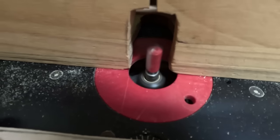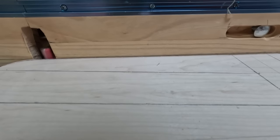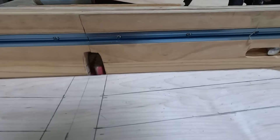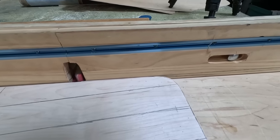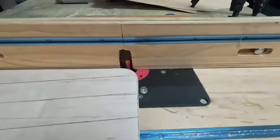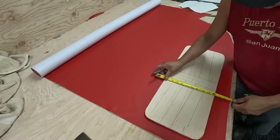Check this out — when I cut that piece of wood and put vinyl on it, it grows. The big piece grows. So if I go with this wood and put it in there, it's not going to fit because the vinyl makes it grow — and when I get the vinyl for this door panel with the foam it'll grow even more. That's why I bring it to the router and cut a little bit — now it can fit.